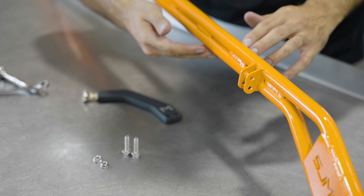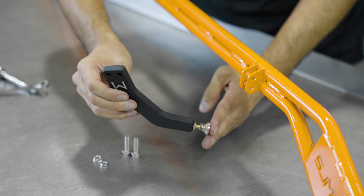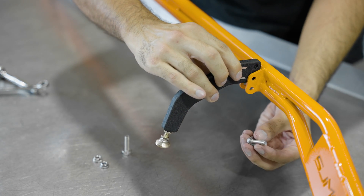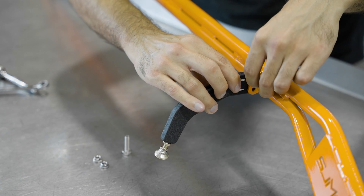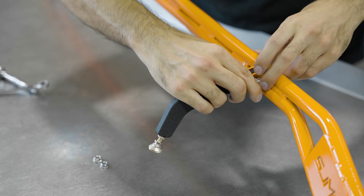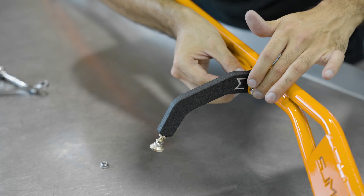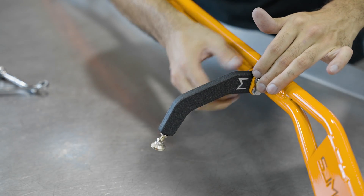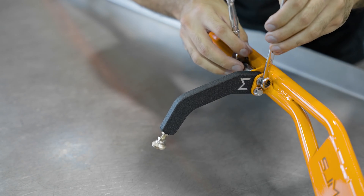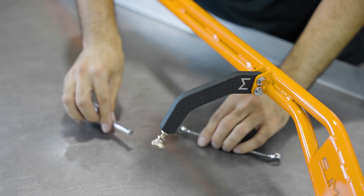Looking at the underside of our bar, you've got the two tabs where the master cylinder brake brace will slide into. Really straightforward — with the foot towards the firewall of the car, this is going to go right in between these slots. You're going to grab one of the two supplied bolts and get them started in the holes on each end, then pop those through and grab the M6 nuts and get them started. Using our ratchet and wrench, we're just going to snug them up.